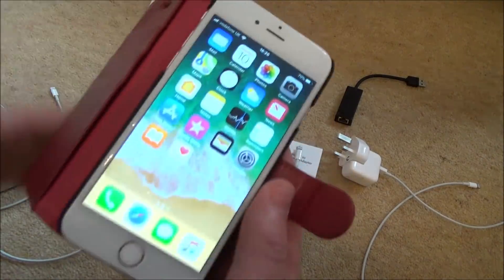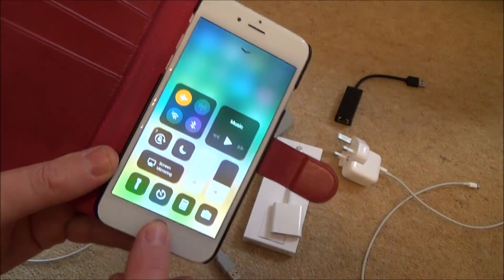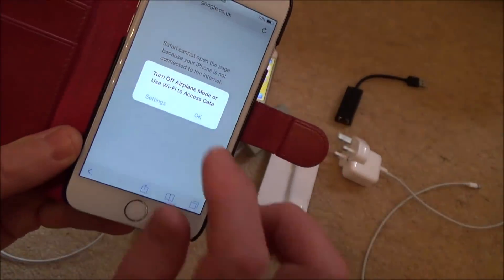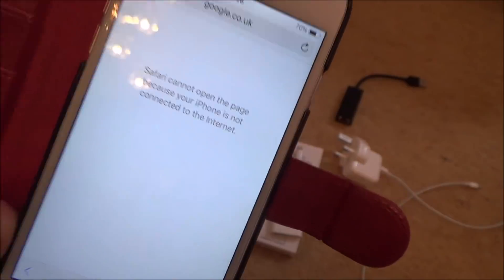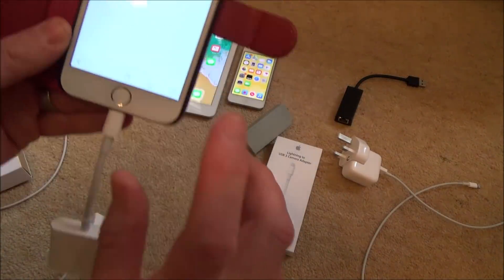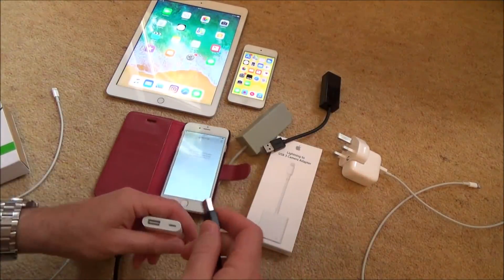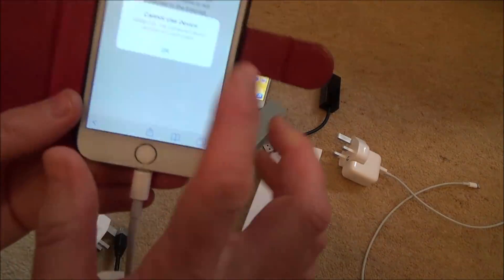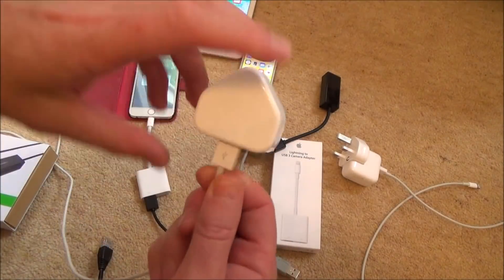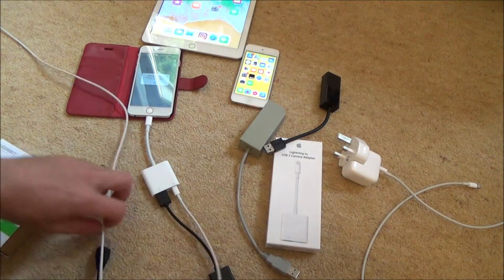To get it to work, let's go on to this phone first. We're going to put it in aeroplane mode to show you it's actually using the Ethernet cable. When you're in aeroplane mode normally you can't connect to the internet — Safari will say it cannot open the page. So we get the camera adapter, plug it into the bottom, and when we plug in the USB Ethernet adapter it will come up saying there's not enough power. Make sure we're using the USB 2 one — and yes, it says the connected device requires too much power. That's not a problem; all we have to do is plug in the iPhone charger, which is the reason you need the adapter that allows you to plug in the Lightning connector.